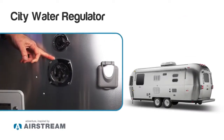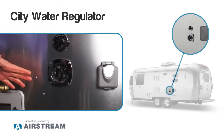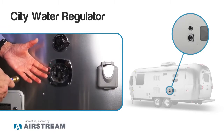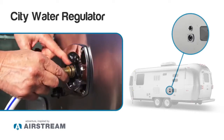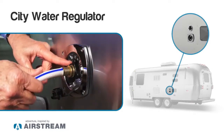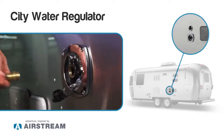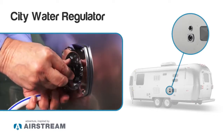Next we want to talk about the city water regulator. If you choose to not carry the water on board, you don't want to haul around the extra weight that 40 gallons of water will be. When you get to the campsite, you can get a regular hose, screw it on there, and turn on the water supply, and now you have water pressure to all your plumbing on the inside. Water heater, the sink, and everything will go through there, and you won't have to use the water pump.